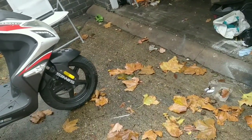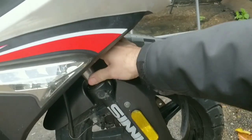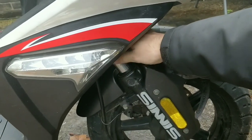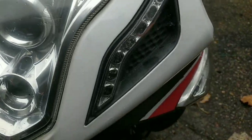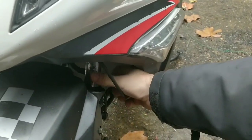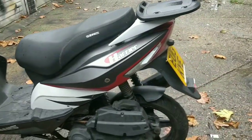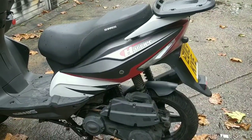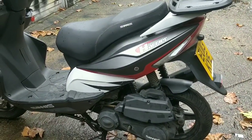Your average Joe can't easily check their shocks, I get that, but give them a bounce and if they're overly wet then you're in trouble. This pitting could be an issue - I don't think it is, it's smoother than it looks, but it could be. There's no actual residue on this shock so they're not causing any problems to the flow at all. If you're really worried, you can sneakily put some tubing over your shocks - they don't take off the tubing. That's only if you've got a bit of pitting and you've cleaned it and made it better - I'm not encouraging anyone with stupidly weeping shocks to do that.